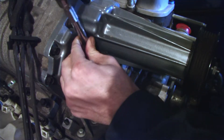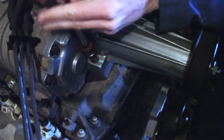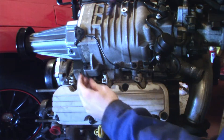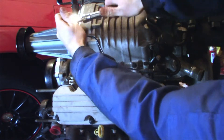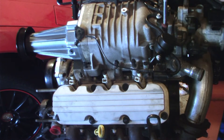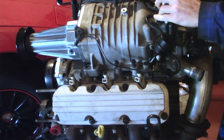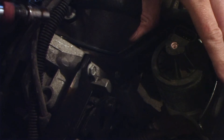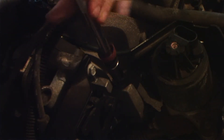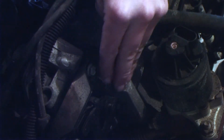On the same side, we also have one hiding behind here — behind the snout. Now we'll work our way to the other side. On the opposite side of the supercharger, we undo the four bolts here, and there's one hiding back here as well. We also have to remove the EGR heat shield bracket, as well as this bolt which also ties down the supercharger.